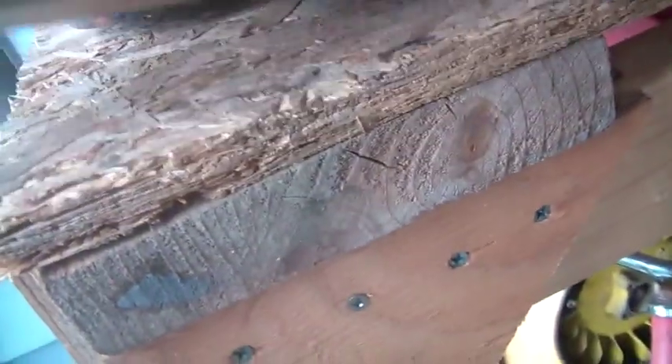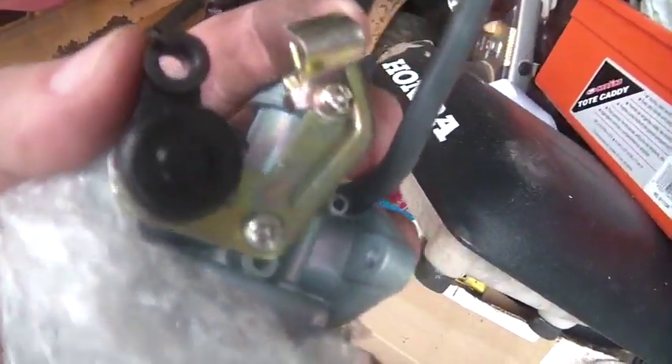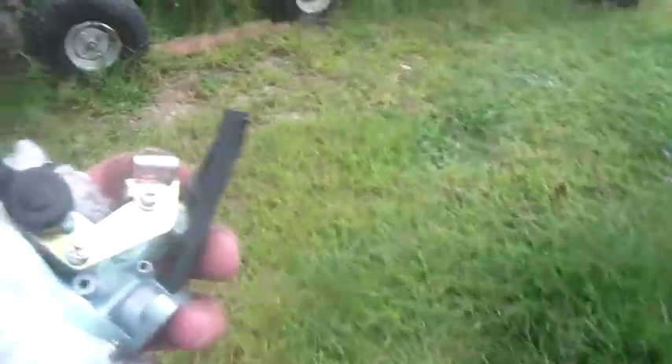Excuse the bad camera work — this is the second of those carburetors that I bought. They were like 16 or 17 bucks each, so I bought two of them. I'm unwrapping this one to show you the way the choke is. It has a cable choke — you put the cable through this thing here, and when you pull the cable it closes the choke. I got to show that for a specific reason: when I went to bolt the other one onto the bike, all this was too tight up against the frame so I had to remove it.